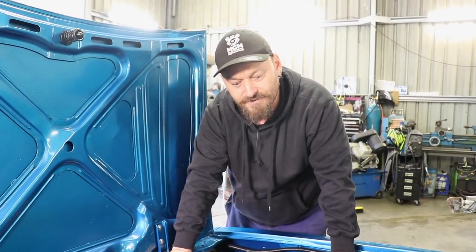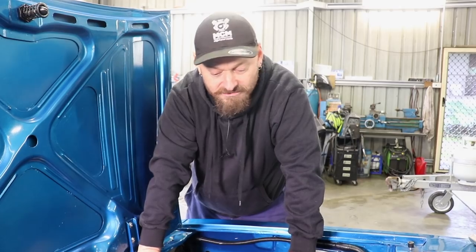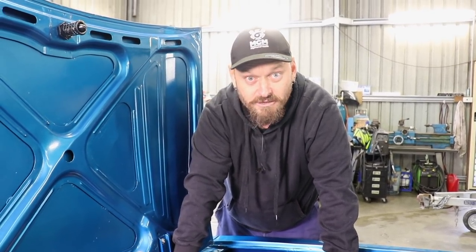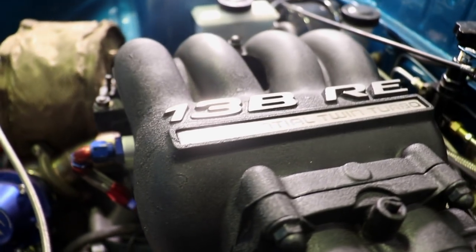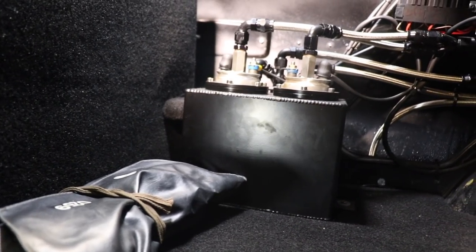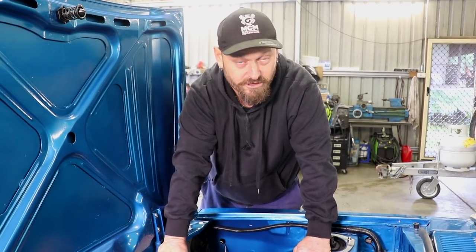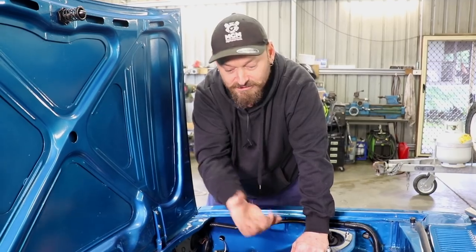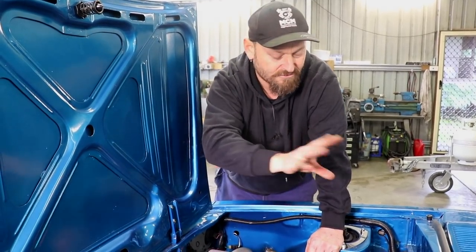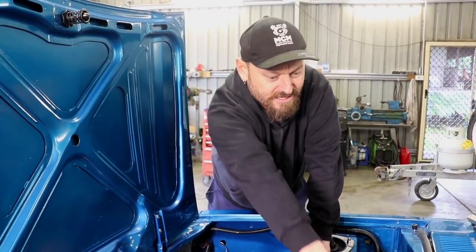The fuel system is pretty big. It's set up to run E85 although it's not actually using it at the moment because it's not really needed. It's got 2200cc Bosch injectors — four of those. Rotaries are very thirsty animals; they love a drink. Particularly when you've got to run E85 you need some pretty big injectors, which can make it a little bit difficult to tune, but if you've got a decent ECU like a Haltech it's not a problem. The fuel system's in the boot — it's got a couple of Bosch pumps inside a surge tank, and then there's a Carter lift pump mounted in the factory position where it used to have an electric pump. The fuel tank's been modified for AN fittings; it's all AN Speed-Flow all the way through. The fuel filter's mounted in the engine bay — you can see it's a Speed-Flow fuel filter.